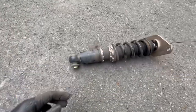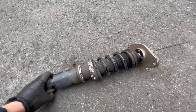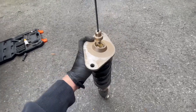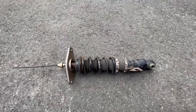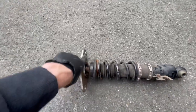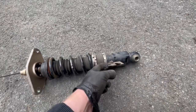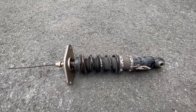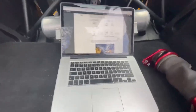Out come the coilovers — a little bit dusty but in really good condition. There's a tiny bit of surface rust on the spring, but you get that with used coilovers especially in the UK with salt on the roads. The BC coilovers are in really good condition for their age. Rear suspension is super easy on the R56 to remove: one lower bolt, two bolts through the top mount, brake line and handbrake cable through the bracket — just pull those off. Very similar process on the R53 as well.